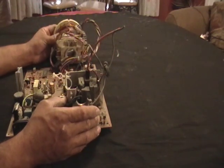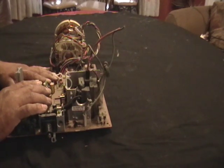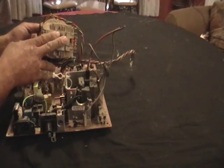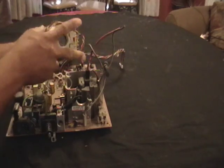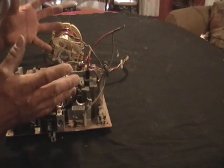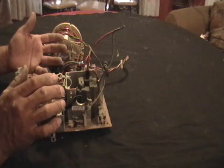What I would tell you is: be careful with these monitors. Some of these carry a charge of like 25,000 volts. What I did was, when I lifted the lid, I just popped it right off, then started cutting the cords with one hand. Don't touch with both hands — if it still holds a charge, you don't want to get shocked.